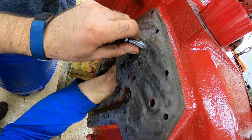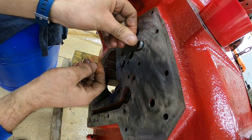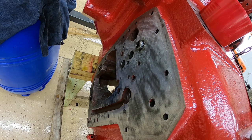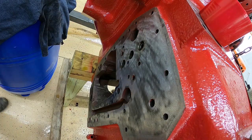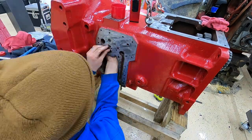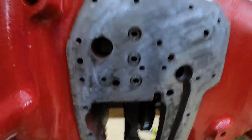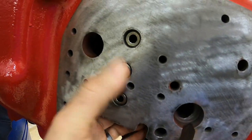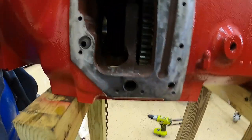Take some more Hi-Trans fluid and get it lubed up in there so we don't tear the o-ring when we push it through. Push it in as far as we can and then knock it the rest of the way in. We got our three tubes in there — everything went in pretty easy. The top tube goes in a little further than the rest of them, but they're all bottomed out. Not really sure why that is, but if you know anything about it you can leave a comment below.